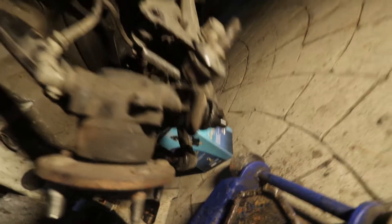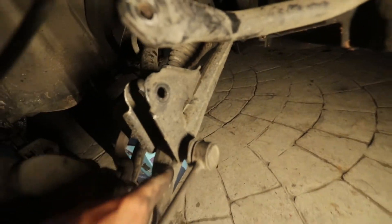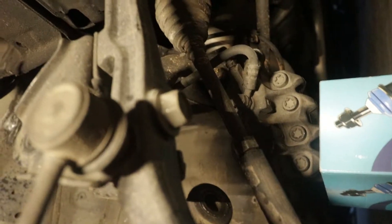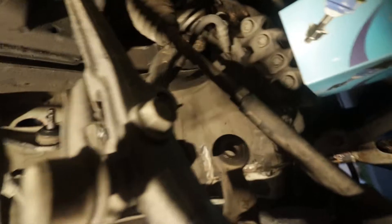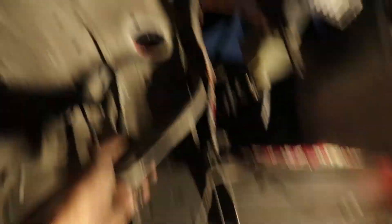Quick update - we got the stock strut out, the brakes off, basically everything's disconnected, just gotta hammer that off. This arm and this one are actually brand new, just doesn't look like it. But if you look under here - I've only got one bolt when there should be two. There should be a second one under here but it didn't line up because it was so crappy. You can see it right there - missing a bolt. So I'm gonna get to replacing those control arms, but first I'm gonna pop this upper in.